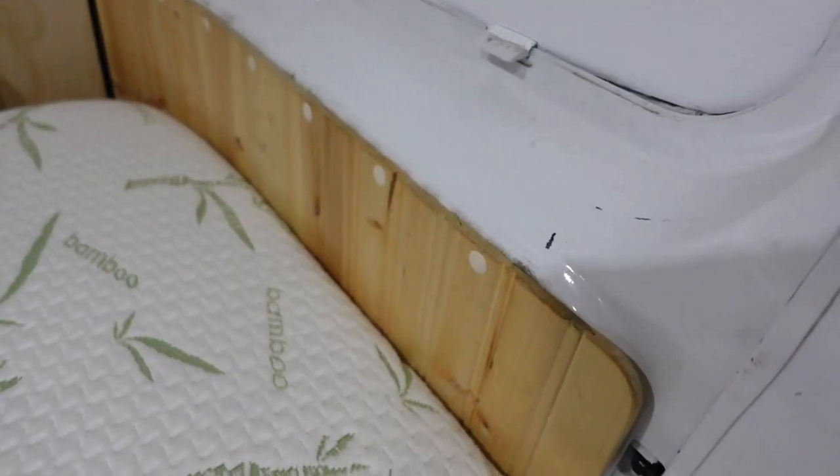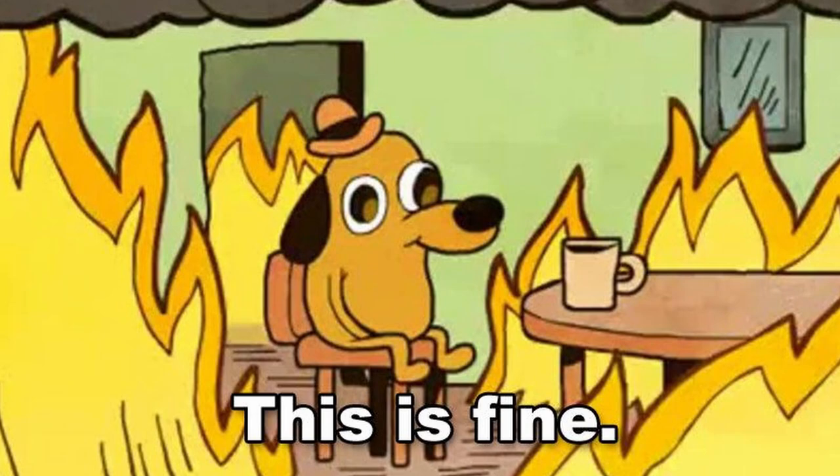However, I used the back doors as one of those encasing points, meaning the bed is directly pushed up against the back doors, which led to two different problems. The first issue is that the bed puts outward pressure on the back doors, and when there's outward pressure on them the seal that stops water from getting in gets compromised over time. So every time it rained heavily, water would drip inside the back of the van right next to my head while I was sleeping. I even had to sleep next to a bucket for a few months until I figured that one out.